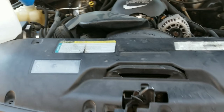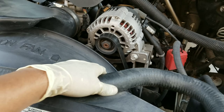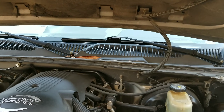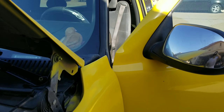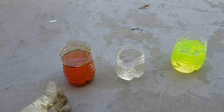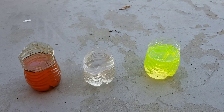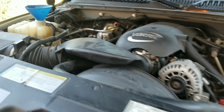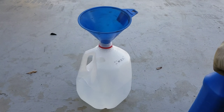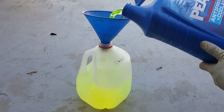Once we have the 50/50 mix ready, we'll fill up the truck and let it idle for about 20 minutes until the hoses are nice and hot, then do the same warm-air vent test. Just look at the progress we made — we went from the original red color to clear, and now to a 50/50 antifreeze mixture. This color is going to help the car cool off much better. I'm using half distilled water and half concentrated antifreeze to make that 50/50 mixture.